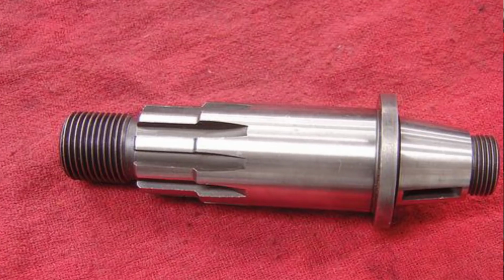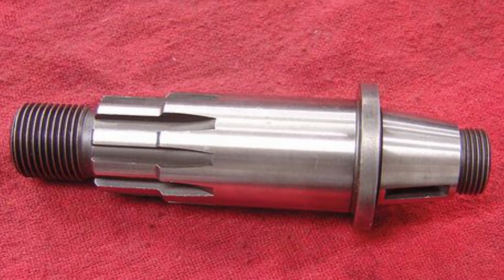Now this looks strange. What I'm actually doing is making a tool here to set up Timken bearings. So we've got so many cases going together. I needed a couple of extra tools in order to set up Timken bearings for the cases, to set the end play for the crank, of course. Now, one way you can do that is to get a dummy shaft off of an Evo or older, and then weld it to a base plate so that you can then secure it to a vise.